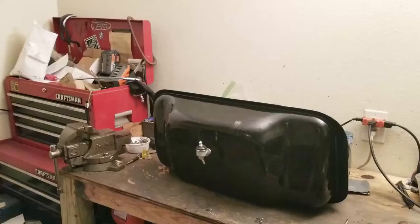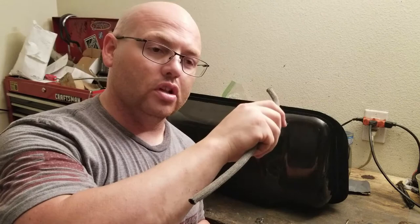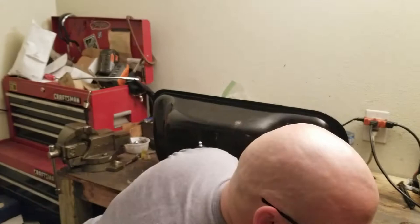All right, guys. So I like to use the right kind of clamp on all of my fuel hoses. I've also got a reducer here, which takes the 5mm fuel hose and makes it compatible with the electric fuel pump that we installed. So I go from the actual 5mm hose to the larger hose, which I think is, hold on a second. I don't want to lie to you. It's dumping gas all over the place. I think it's like 5/16. I could be wrong.